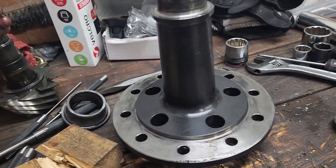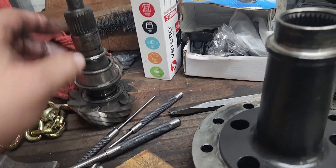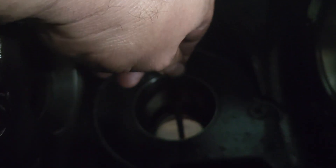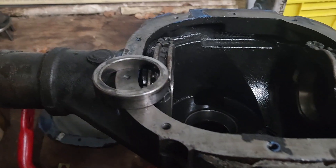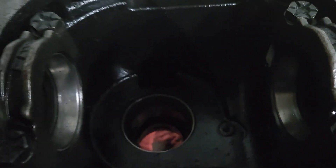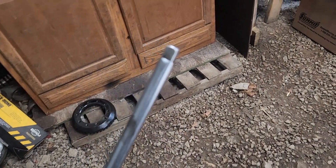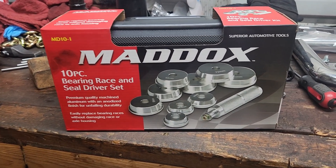Now on this one, we're going to get the new pinion. I've got an extra bearing and we're going to run a sanding wheel inside of it to make it so it'll slip off and on, so we can set our pinion depth. But since we've got our punch and hammer out, let's go ahead and knock this race out. We'll hit it on this side, then on this side, and it'll pop out the front. Then we'll roll it over and knock this one out the same way. Let's check out this Harbor Freight race driver set.